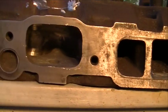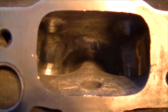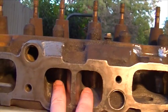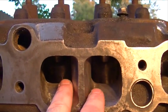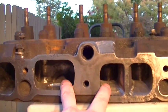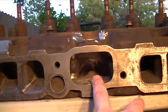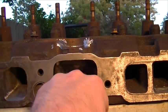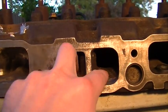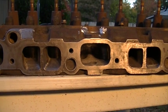I'm going to keep working on this — I've made quite a bit of progress. I got this intake runner ported out, still got to machine my little flat spot in there. But these exhaust runners are finished. We've got number one cylinder finished, number two cylinder finished, number three cylinder finished, and number four cylinder is halfway finished — the intake port's done. I'm working on the number four and number five exhaust ports. I'll keep working on this and keep shooting some video.